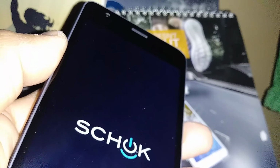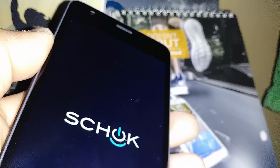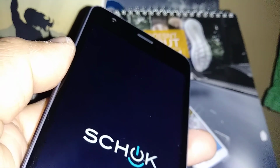Okay, so if you get stuck here more than 8 minutes, that means there is a problem there. So like I said, just remove the battery, wait 10 seconds, start over again the same process until you are able to get the initial setup screen.